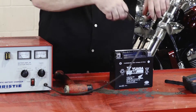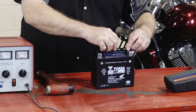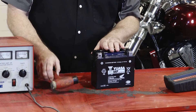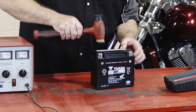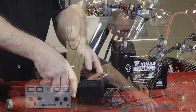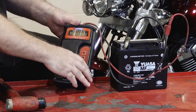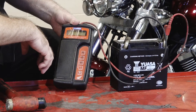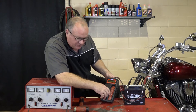She is finished charging, so let's go ahead and disconnect. Next step, go ahead and get this cap back on. You definitely want to charge it with this cap off — you don't install this piece until it's completely charged. At that point the battery is sealed back up, and you'll never have to take this off again because this is what they call a maintenance-free battery. Just for kicks, let's hook it up and see where we ended up: 13.10 volts — I'd say this one's pretty hot and ready to go. It's a YTX20 ready to install. That tells me everything I need to know, so let's go ahead and get her in there.